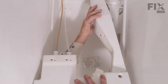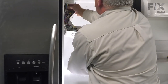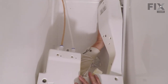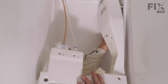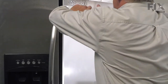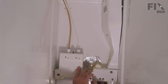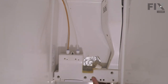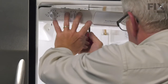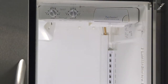Then press it into that tube and up into place. Next, we'll reconnect that wire harness — line it up and make sure that both locking tabs engage. At that point, we can tilt that housing up into position. Then just support it with a single screw at the front center. Make sure the screw is protruding through the top and line it up with the opening. That will hold it in place.